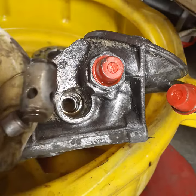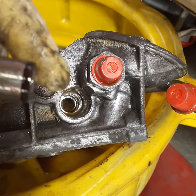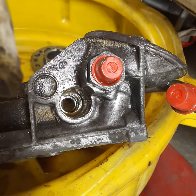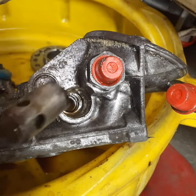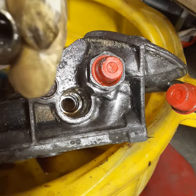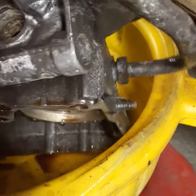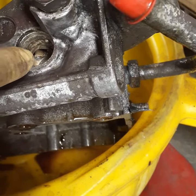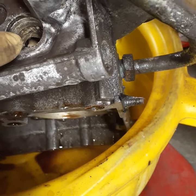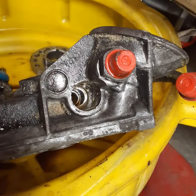I got lucky — it came out on the first try because it's just sitting down in there. As you can see, it's got a port in the bottom. It's hollow. The port's on the side where the oil can come out. So as this gets pushed back into the spring, the oil will bypass inside there — you can see that hole right there. The oil will bypass and allow the oil pressure to drop so that you don't over-pressurize your system.